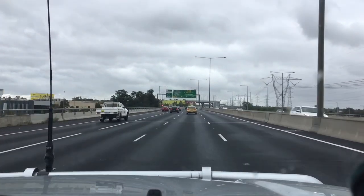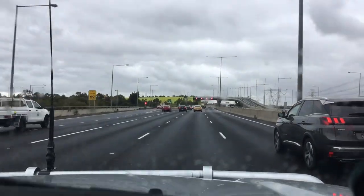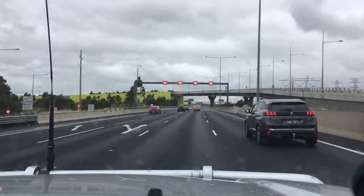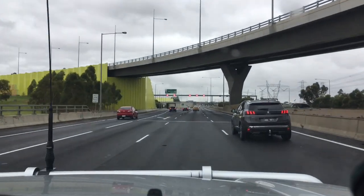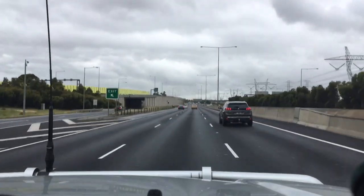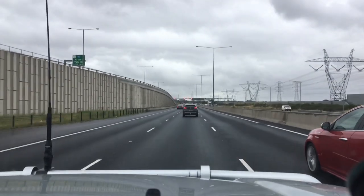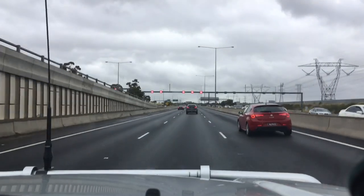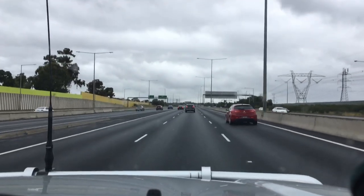That's where the air exits. If you've got your windows down a bit, the air will go out there instead of traveling all the way to the rear vents. Now the problem you've got is if you're traveling in dusty conditions with it on fresh, windows up, and the fan on medium — say two or three out of five — you've got a certain cabin pressure pushing out those vents, which helps keep dust out. Lower fan speed or switching to recirculate changes this.